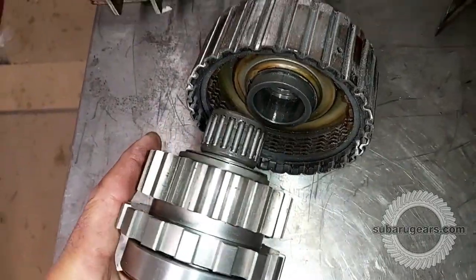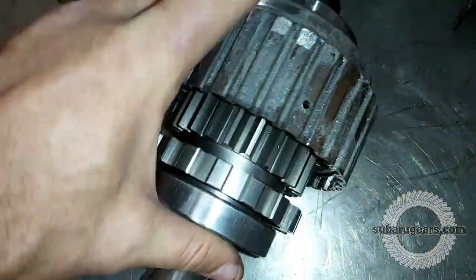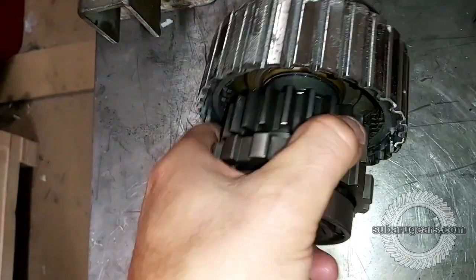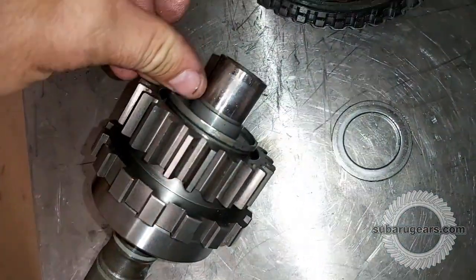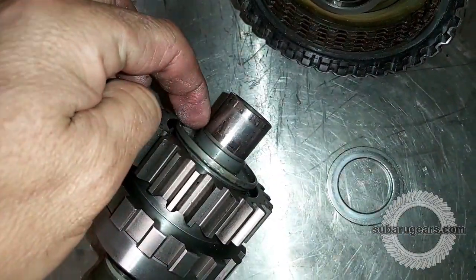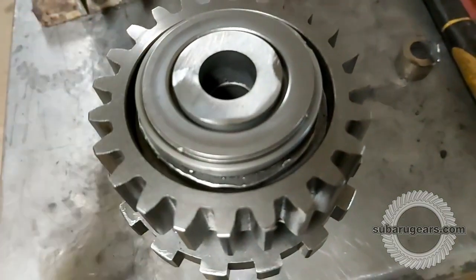With the assembled shaft you'll see there's a thrust bearing and a needle roller bearing. This needle roller bearing was used to locate the AWD clutch pack onto the shaft, but it's no longer needed. So we need to cut off all this material down to just the inside, so we still have support for the thrust bearing but no longer the extra length needed to fit the cover on. This has been cut down to less than 6mm. Give it a clean, put the thrust bearing in, and it's now ready for assembly.